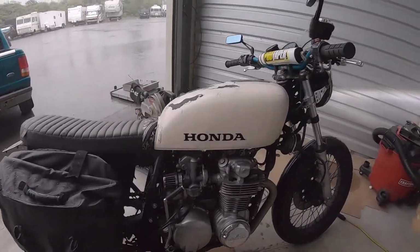Stewart's usually has that, upstate New York. So like the older bikes, they don't really like the ethanol. So if you get the 91 and put it in these, it breaks down slower also. And the older bikes, they run a little better. But it's running.